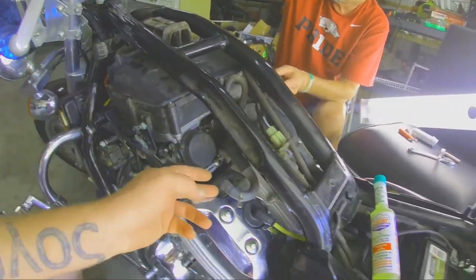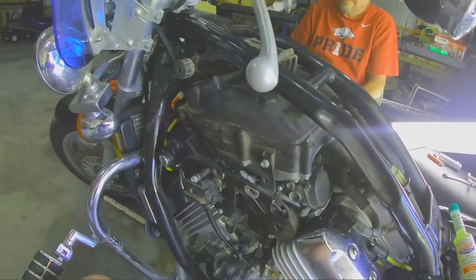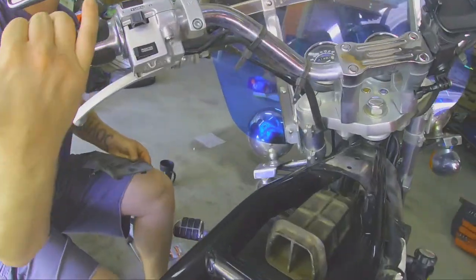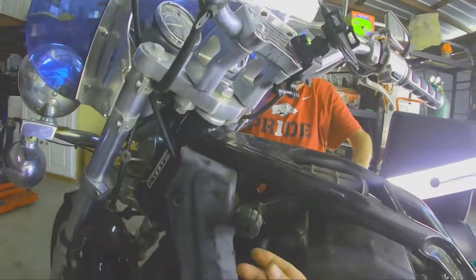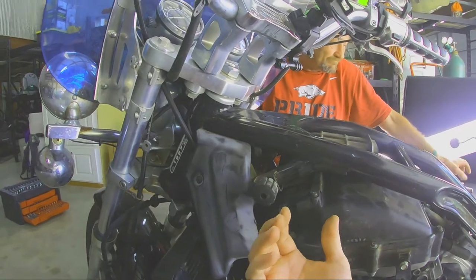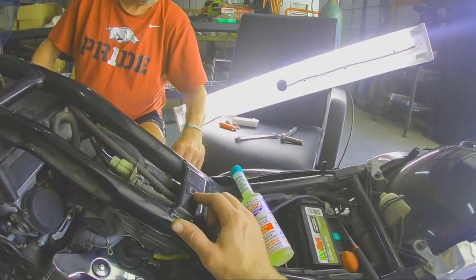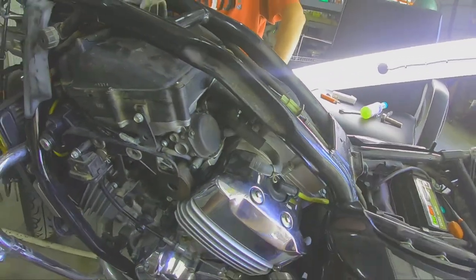At this point, pretty much all we have left is fuel lines, stuff connecting to the tank, and bolting the tank down. On the underside of the tank, there's a little C-shaped piece of metal — it's just going to hang there. Between that and this bolt right here, that's all that holds this tank on, unless you want to count your fuel lines. This is what's going to slide onto those rubber grommets — just a little wiggle and they should pop on there. You'll know they're in the right spot when the hole aligns up.